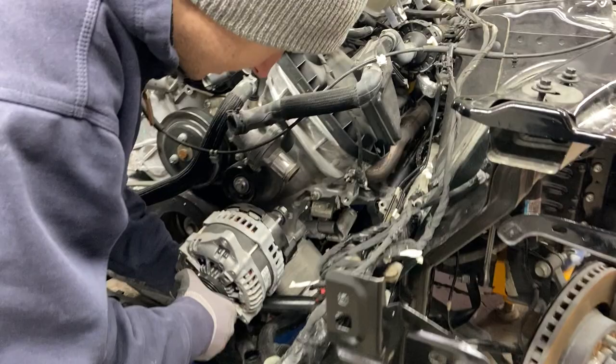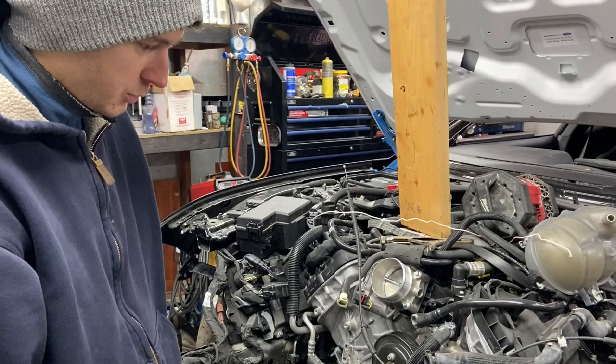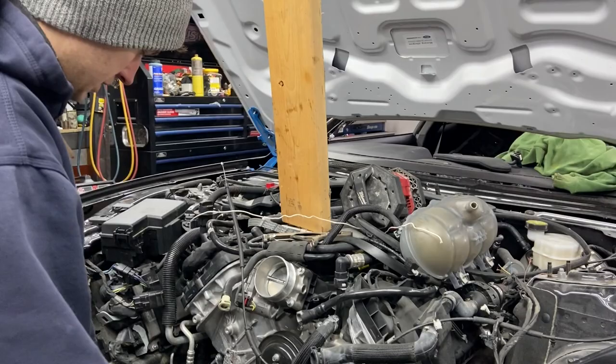So did you guys drop the cradle when you took that off? No. So you got room. Oh. All right. Okay, that's where it goes. You might not have to drop the cradle, but you'll have to remove a lot of stuff from the front of the car. There's airbags right here, and what other things. Air box, the radiators need to go, and it's gonna take some time.